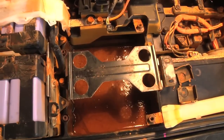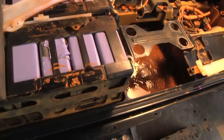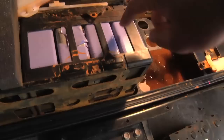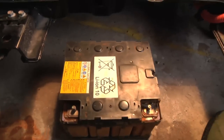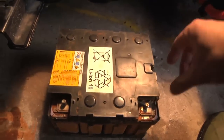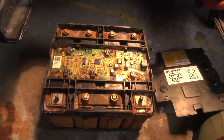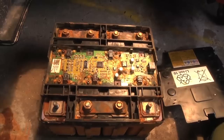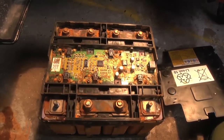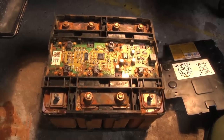Right here is a spot where one of these blocks of cells is missing. What these are is groups of one, two, three, four lithium cells all assembled together as more or less a 12-volt battery — we have one of those right here. This is one that I took out and scrubbed down in my bathtub. Inside it are four 50 amp-hour lithium manganese cells connected with bus bars, and right on top is a circuit board for battery management.